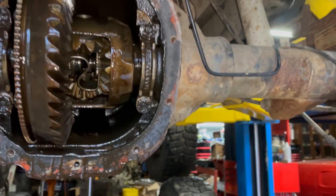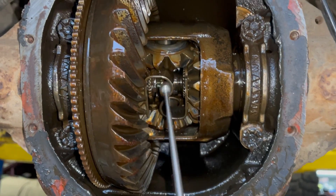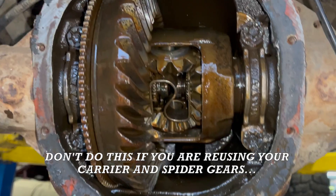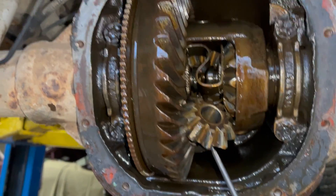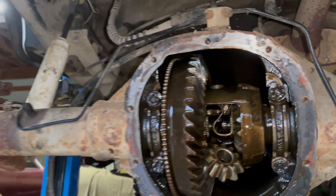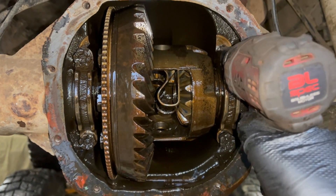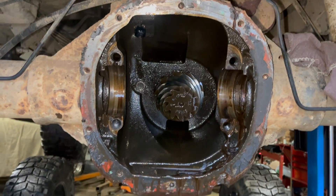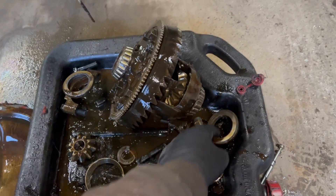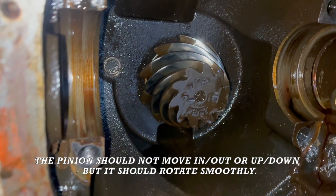How about you just rotate it 180 degrees forward and let all the spider gears fall out? Some of these are extra. Slide the axle out. Carrier coming out. Empty housing. Carrier. Braces left and right. Cast iron shims — I assume and hope we'll be reusing those. I should not be able to move the pinion by hand — that's not ideal at all.